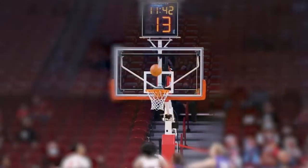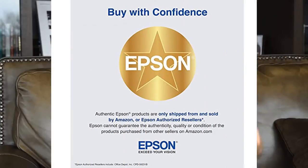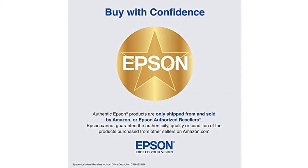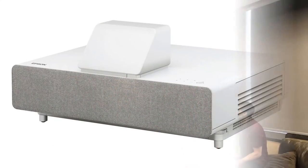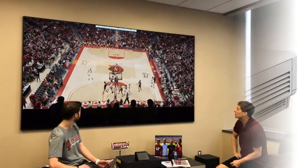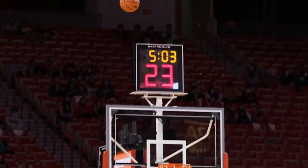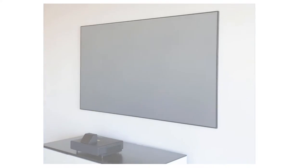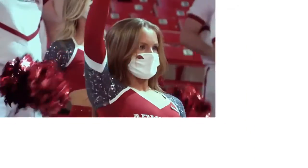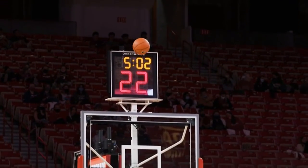For creating the image, the light source is paired with three 1080p LCD chips and an approach to pixel shifting that doubles the number of pixels per frame on screen. This gives the image only half as many actual pixels as a full 4K image. But when you compare Epson's 4K Pro UHD projectors side by side with DLP projectors that put a full 4K array of pixels on screen, there's little to no difference in apparent detail. In some cases, Epson's approach actually provides better resolution in the sense of ability to resolve detail.